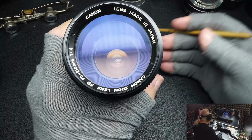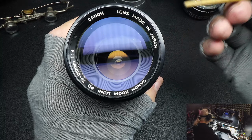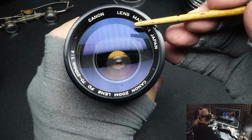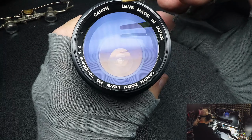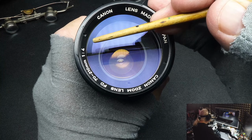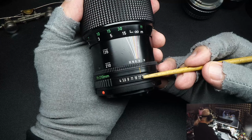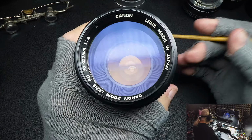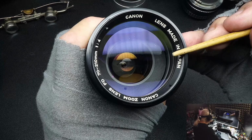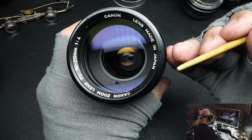Well, say you were a nature photographer and you needed a very powerful, expensive telephoto that cost, say, $1,000. If you could find one that had a scratch right along the edge, I know that's a horrible thought, but if it wasn't too deep and it was like 1/4 of an inch long, say 1/2 inch in maybe, no more, you could get by using your higher f-stops, not 4 or 5.6, but up here, and using a lens hood on the front. You don't want the light to hit that scratch, so you always want to make sure it's shaded by a lens hood when you're using it.